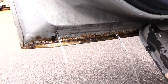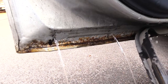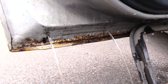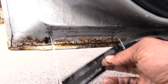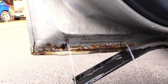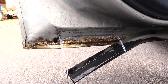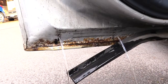I'm going to let it just sit here for a little while so it can drain this water out. This is a problem a lot of times with older model Chevy Impalas, possibly Chevy Malibus, or just any car that could get water inside of it. Look down at the bottom of the door and see if you see a piece like this, and if you do just pull it out. You don't really want water to stay in there because it'll cause rust at the bottom of your door and can start messing with your electrical components for controlling your door.